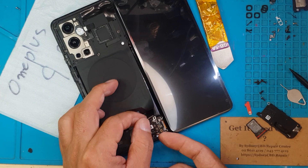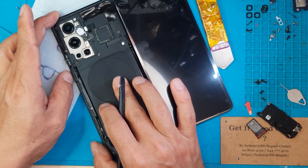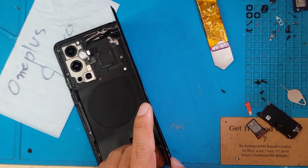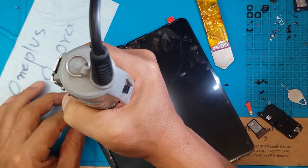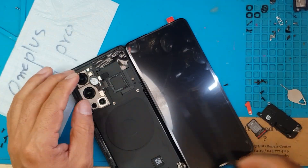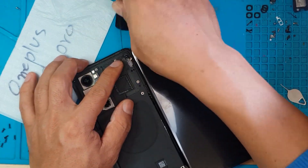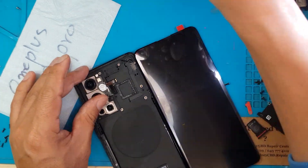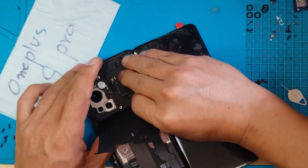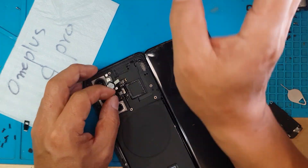We'll put it down and remove the display. The display itself is okay — there are no dead pixels and colors are accurate — but there's something in the board that's interfering with the signal flow to the display. We're going to disassemble the device. As you can see, it's showing some weird images.